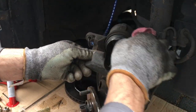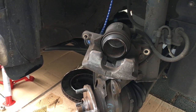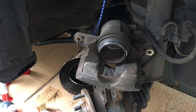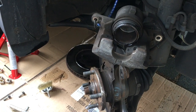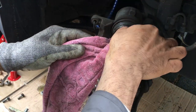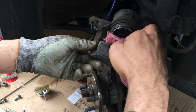It's important not to put any anti-seize paste on the rubber because it will damage the rubber and reduce its lifetime. Use the correct synthetic grease or silicone grease. Don't be too generous because you don't want grease to come in contact with the brake pad and brake disc and weaken your brakes.